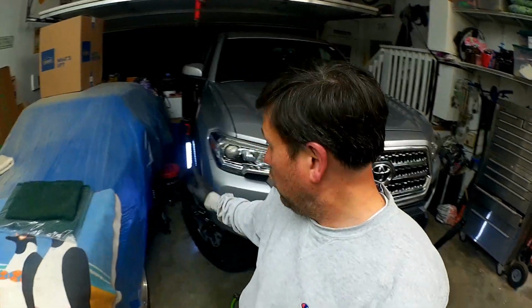Right now my current spare tire rim wouldn't work with that 3/4 inch spacer. Now it will work perfectly fine with the 1 inch spacer because the lug nuts are completely covered. There's no issue whatsoever, so I can continue to use my original stamped steel spare rim. I like the idea of having a matching spare, but it's not necessary. It's an extra $150 that I would have to go find on eBay or somewhere. Hopefully this is helpful to you.